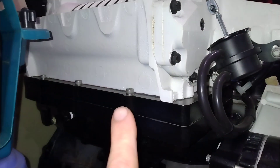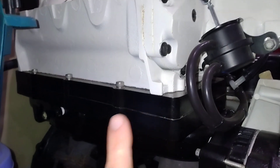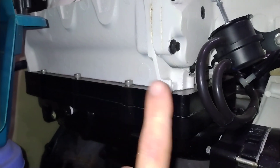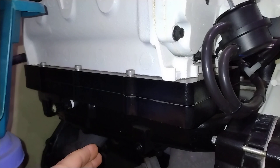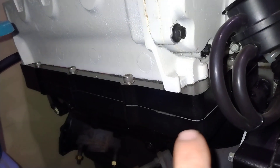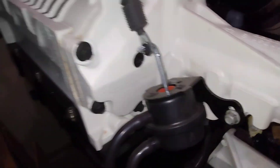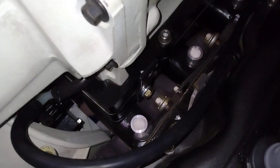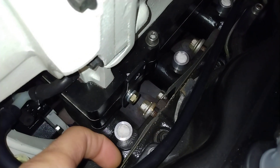For the upper plate on the supercharger, the plate is routed out as big as possible around all the bolt holes that bolt up into the supercharger, all the way around the perimeter, and then routed out as much as possible for airflow to come out of the front of the supercharger, get squeezed, and go down into the intake. The match plate is a little bit bigger so you can bolt the plates together. It's not really that difficult, but a lot of planning has to be done because it's so wide it takes up room for the injectors.